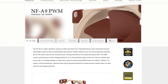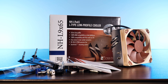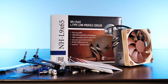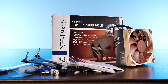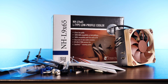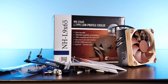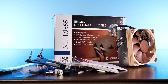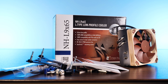To finish off, the box will contain the usual amount of stuff: mounting hardware for LGA1700, LGA1200, LGA1150, 1155, 2066, and 2011-3 or 0 for Team Intel. Over on the red side, we got hardware for AM4 and AM5, as AMD decided to repurpose the mounting holes. For the rest of the box, we got thermal paste, screwdriver, and so on, as well as the special little low-noise adapter, which allows you to limit the fan's max speed to 1800 RPM in case you are not able to use a PWM controller for some reason.